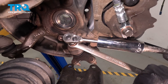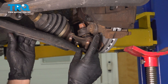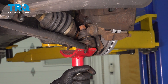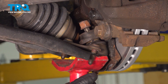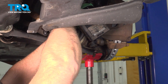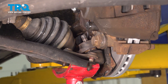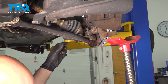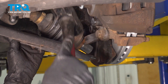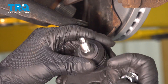That's not allowing me to do it, so I'm just going to put the studs back in the lower control arm to stabilize it a little bit, and use a pole jack underneath — just put a little bit of pressure. Using an 18-millimeter socket, we got that loose. Take that nut off and lower the pole jack. Pull this down. You can use the pickle fork if you need to, or just tap it out. On the new ball joint, there is a hex key that you can use to hold the stud from spinning.